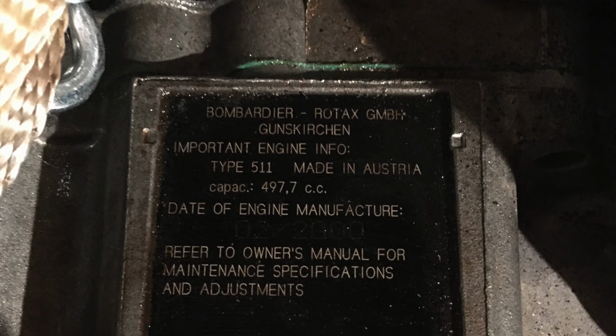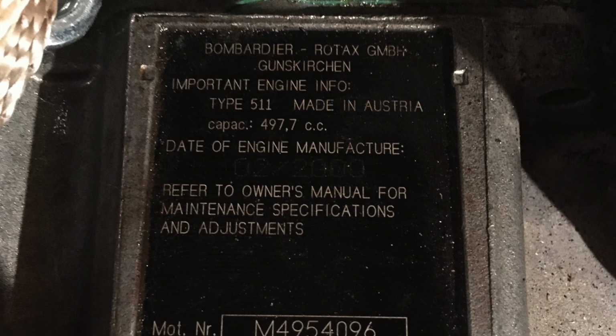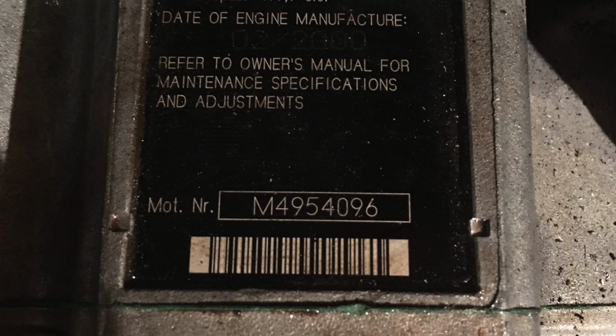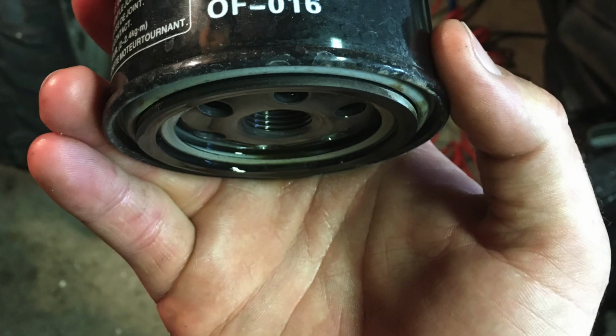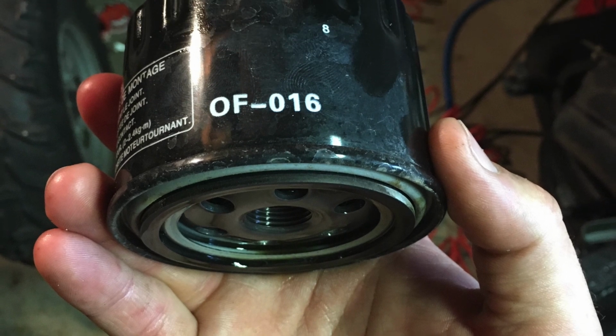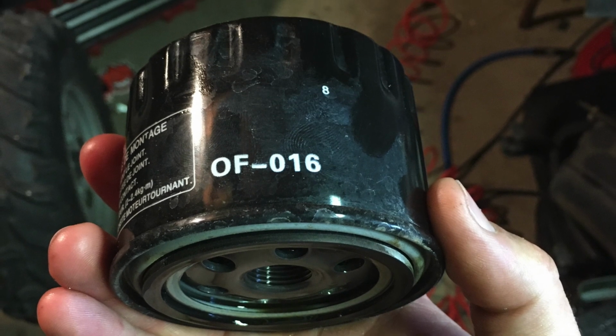Okay, so I thought I'd do a little commentary to add some more information that wasn't mentioned in the video that might be nice to know. Number one, of course, drain the fluids before you start. You're going to want to drain the coolant and the oil, because if not, when you open the ignition cover, they're going to drain anyway. So get that taken care of at first.